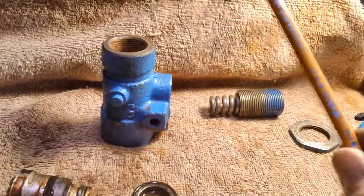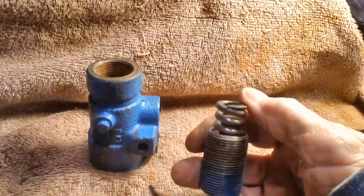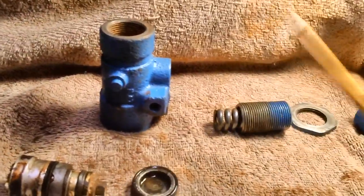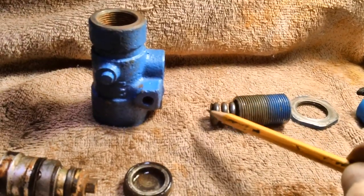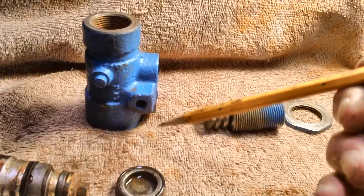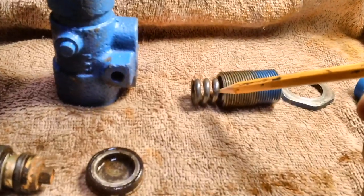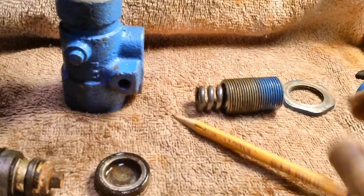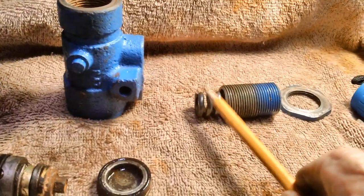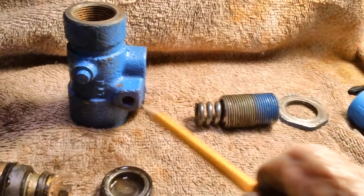Now the rear brakes, where the drum brakes are, have to go through this proportioning valve to get there. Now this spring, the tension in this spring, by screwing this thing in, you collapse that spring more and more. Keep in mind, you hit the brake with your foot, instant pressure goes to the front disc brakes. Pressure to the back lines goes through this, and depending on the tension setting of this spring, once it collapses enough with the hydraulic pressure coming from the brake fluid, it allows the fluid to go through here into your back brakes.